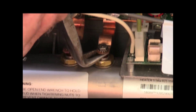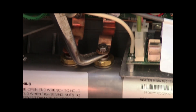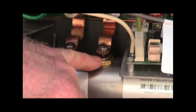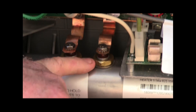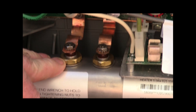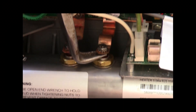Now this is very important. You have a very tiny screw — or nut — down here that needs to be held onto when you tighten this top bolt. These electrodes are held in by a very hard, heat-resistant epoxy, which means it's not like most epoxies that are soft. If you over-tighten this without holding onto that nut underneath, you will crack it, compromise the heater, and your heater will fail — if not immediately, then probably within a year or two. So as I'm showing you, get a good hold of that nut underneath and then proceed with the tightening.